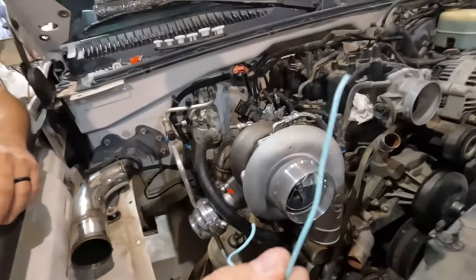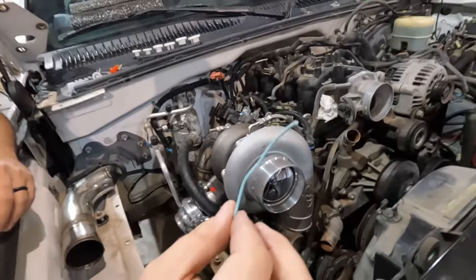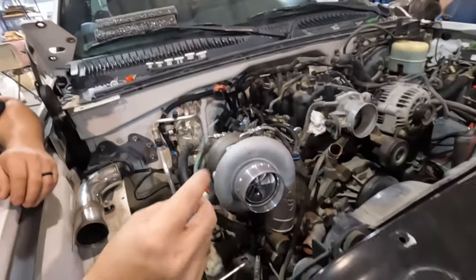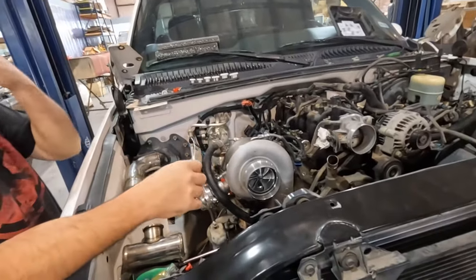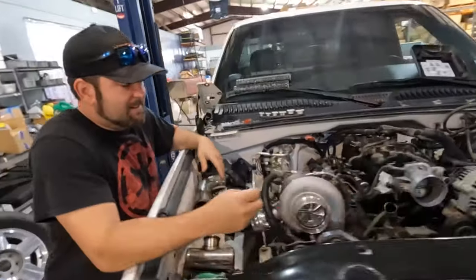This was a power wire. This is a size reference, but I think it's about 20 gauge, maybe 18 gauge on a good day. Yeah, it is very tiny. Not enough to support a pair of fans that are gobbling 30 amps worth of startup in Texas heat, so it got torched. Also, it was wired wrong. It was just completely wrong.